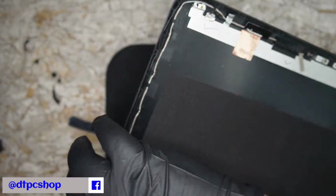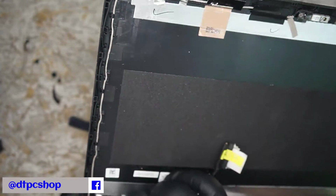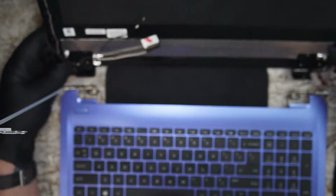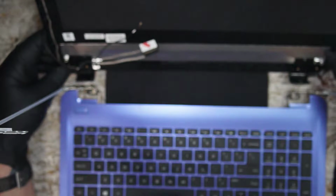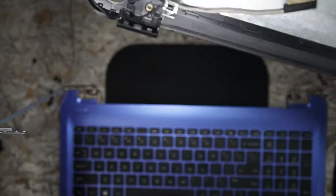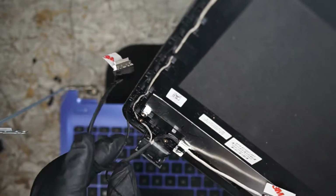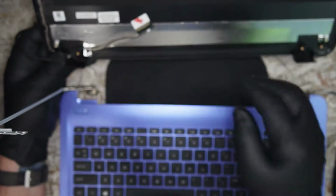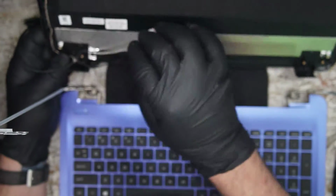That one goes to the display. This one will come down through. Then we need to see which side of the board they have to come in on, going by how they match with the hinge. When you don't take pictures or take notes of these things ahead of time, and you're stuck doing battle. We know that one goes under and then feeds down out. Going by our evidence, we gotta sandwich these behind the LCD connect, or yeah, the hinge, and right here between the bottom part of the hinge, and then this will go out, and that can go out.